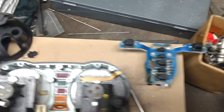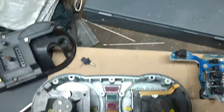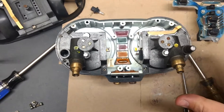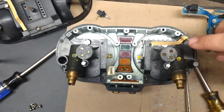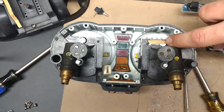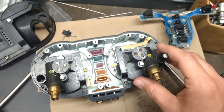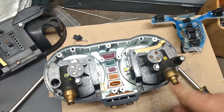Here's the light cluster out here, and the one little socket that you have to take out is over here. This is the point where you can keep disassembling in order to lubricate your worm gear drive. On the speedometer side, I've left in two important screws — there's a large flathead under this seal strip and another flathead right here. The CatDash instructions tell you to leave those in because you don't need to take them apart to install the new LED CatDash.